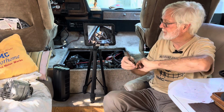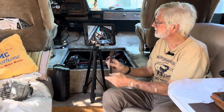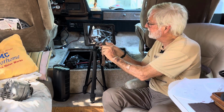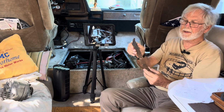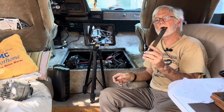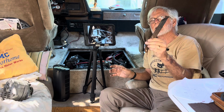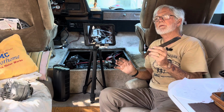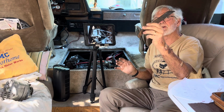All right. So here is our alternator compartment with the alternator out. Now, you have this bracket that comes off the back of the alternator and goes down to the head. A lot of folks will leave this off. What happens is, when you accelerate, your alternator torques down and pulls forward. This bracket is the one that you need to keep it from pulling forward. If you have an alternator belt slipping off all the time and you don't have this bracket, booyah, you know the problem.